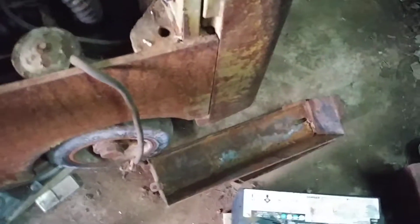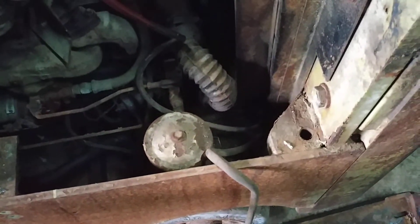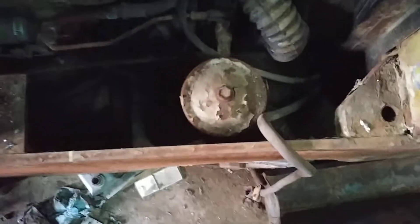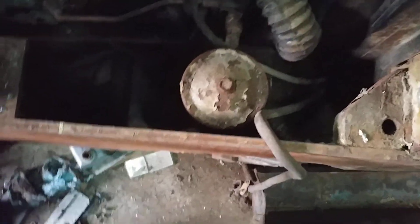I need to revamp the battery tray anyway. It had a battery that size in it and I'm going to put a larger truck battery in it, so it needs to be a different tray. It'll swing out on a pin right there — that's a three-quarter inch pin. The tray would sit in there and then swing out to service the battery and swing it back in.